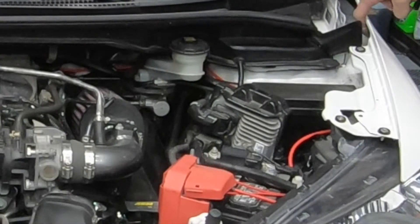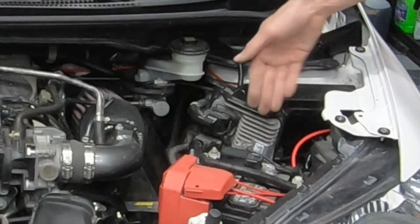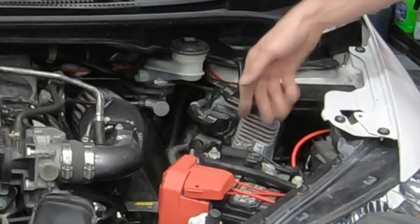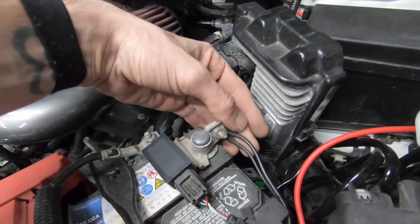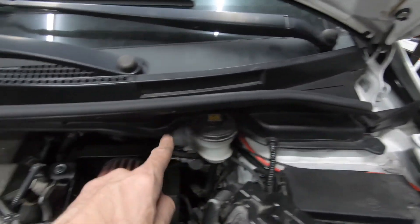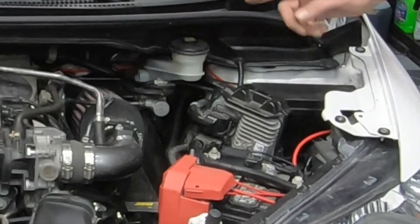Coming in through the fender, I ran along the headlight and put the rest of the wiring harness and the relay on the side of the battery. You've got about two by six inches of room to tape up the harness and shove it in there. One wire goes to the lower LED bar, one goes to the upper LED bar, and you've also got two grounds for the upper and lower LED bar. From the power side of the wiring harness, I ran it back up, around, and then through the firewall. I have another video on my channel explaining how I ran the cabling through the firewall.